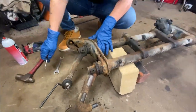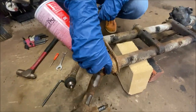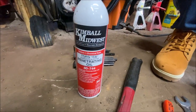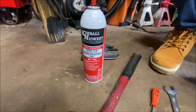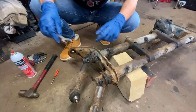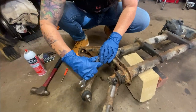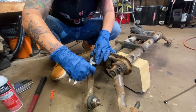You can just take a little pointer or anything and just get the gunk out of there so that the Allen head fits in properly, because you don't want to strip them out. She's spraying it down with some PB. Actually, instead of PB, my daughter's boyfriend got me this — I believe they have it on eBay. He's a mechanic for a living. This stuff works good. I think it works better than PB Blast. It's a 19 millimeter. She's going to bust the locking nut loose. Get it on there and give it a love tap.